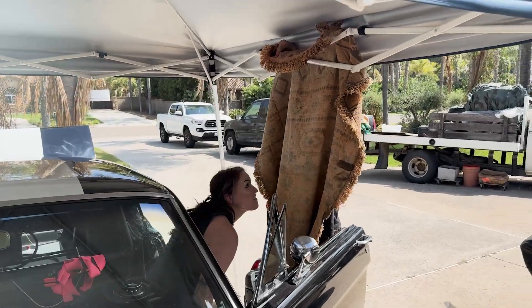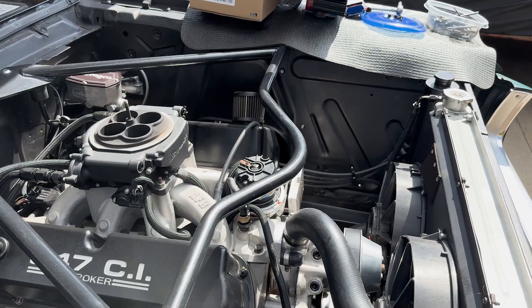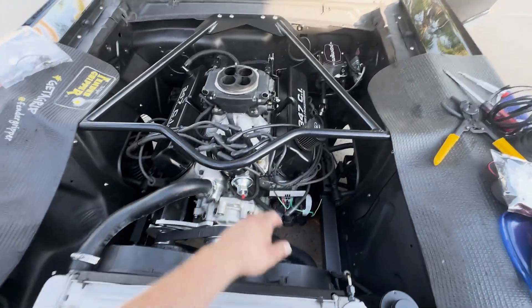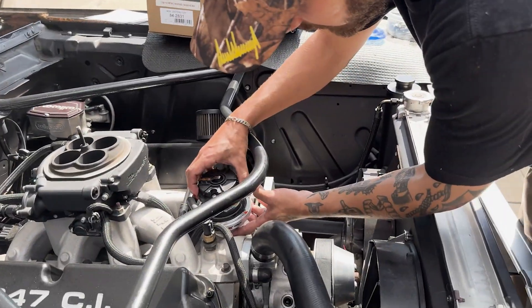Today I'm working on Parker's 1965 Mustang. Parker's going to be helping me, Ashley's doing some work on the interior, and we are going to be installing an ignition system that's going to give full timing control compatible with the Holley Sniper system. This is a 347 stroker small block, T5 in front, running a Holley Super Sniper — the upgraded boost-ready version.